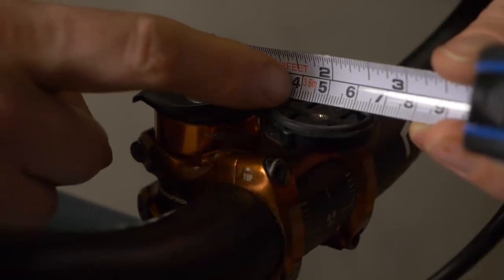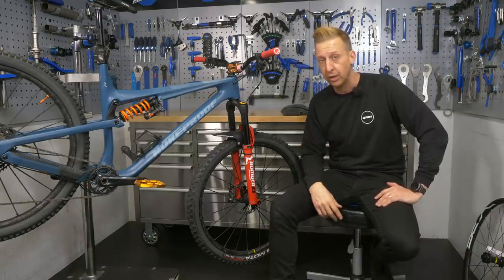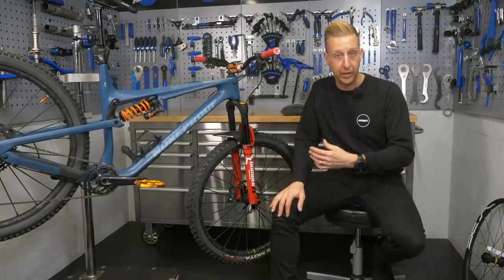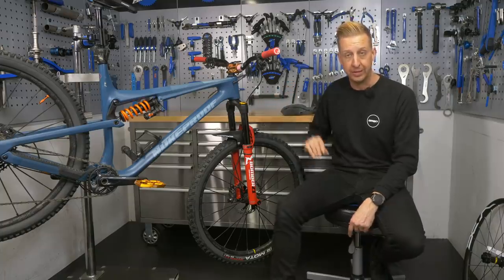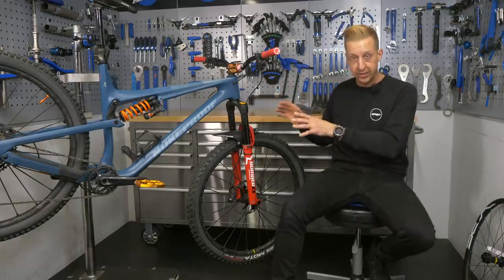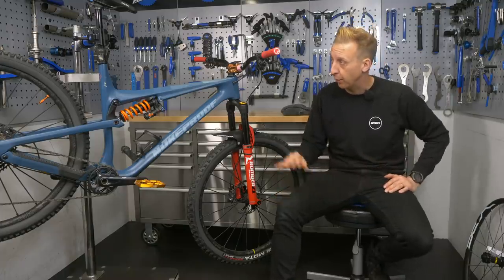Short stems are best — like that one. Well, kind of. They are kind of the best, but you can't just put a short stem on a bike and expect it to handle well. If your bike is a short bike and you put a shorter stem on it than it was designed for, you're going to either ruin the handling or the fit. Likewise, you can't just put a long stem on a short bike to make it fit you — you'll mess up the handling and the whole balance won't work. This bike actually came out of the box with a 50-millimeter stem; it was designed for that length. I've got quite a short upper body but really long arms, so I run a full-width bar and a slightly shorter 35-millimeter stem — and it works out for me without disrupting the handling, because there's a really long reach on this bike.